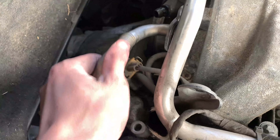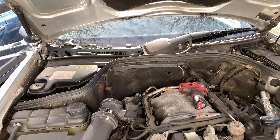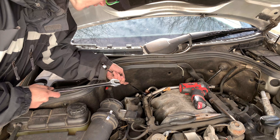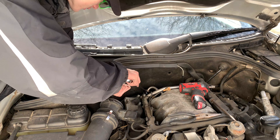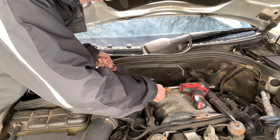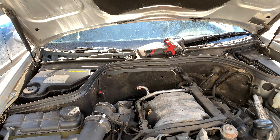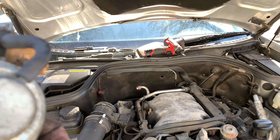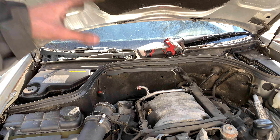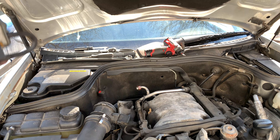Since it's loose, this part's coming off. There's a little connection we have to unconnect, and this hose right here — I need the wrenches, it's a 22 and a 24. That was actually really easy. If you have something on this engine that could have been seized, you better believe it was seized. Taking that nut off, the little threads were a little messed up, so it was a pain. But finally got the old one off. I'm going to leave the metal hose in there because there was no way it was coming out — the firewall being in the way — without taking the intake off, which is not happening.